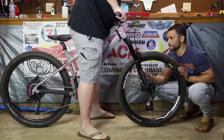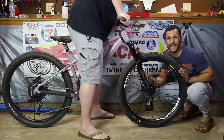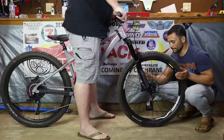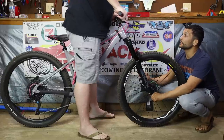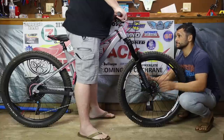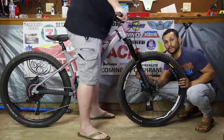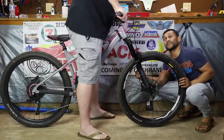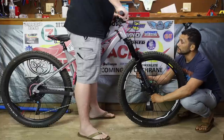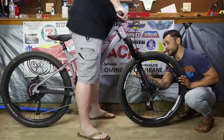Go ahead. And we've got 70 PSI in this thing. Yeah, 70. Well, I tell you what, it's pretty damn smooth, even with a fast rebound. It doesn't shoot back at you. Now that's 3 clicks off the fastest. I don't feel a huge difference in that, but it's not a tiny bit of difference. Okay, that's 9 clicks off rebound.